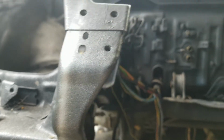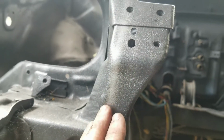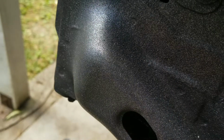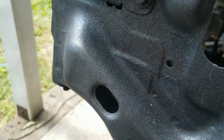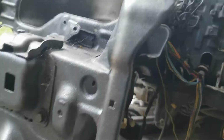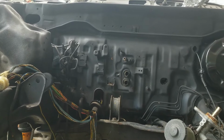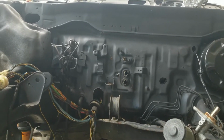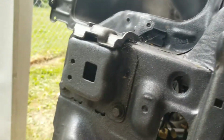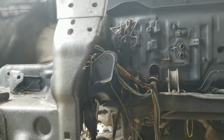It's basically a black primer with a metallic silver just like dusted onto it, and then I'm going to use a 2K clear over it. That might be a better view of what it's going to look like. This was just a test area just to see what it looked like, and the reason I did this is because the primer that I ordered was black primer, and it was supposed to be gray primer. And there's no way that this silver is going to cover the black primer. But I'm going to take a break because it's like 100 degrees outside.